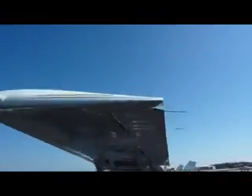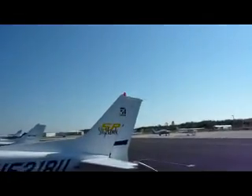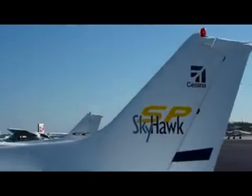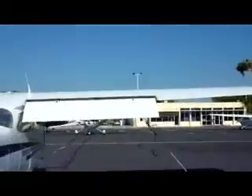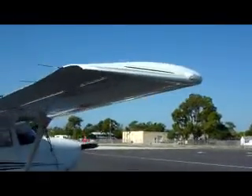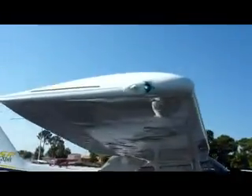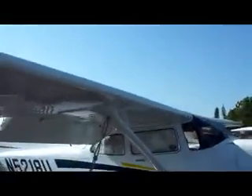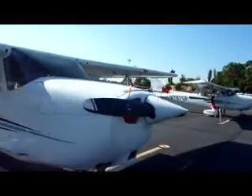The night lights are working, and this is the collision avoidance light — it's working. Walking to the other side, here's the navigation light which is green on the right, and the strobe is working. I'll come back and feel the pitot tube, taking care not to touch the front of it, to make sure it's heating up — and it is hot.